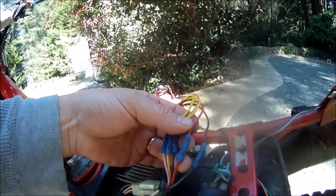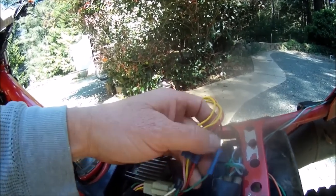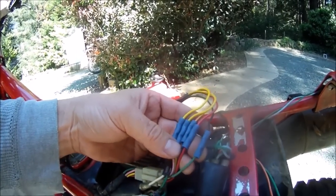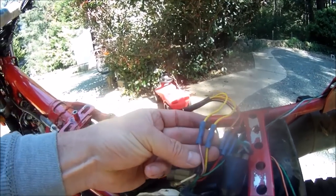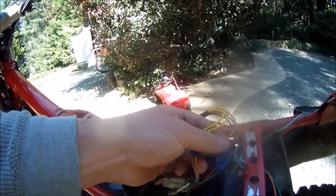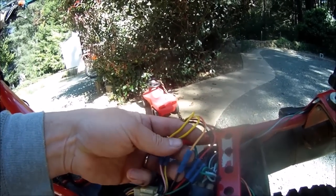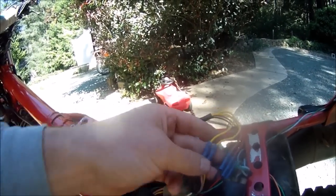Red goes to red — that's the battery. Ground: black goes to green. Remember, on Honda, green is the convention for ground wiring. The two yellow wires — pink and yellow — go to the battery charging portion of the stator. And then one extra wire for the lighting circuit, which goes to the original black wire on the Honda.